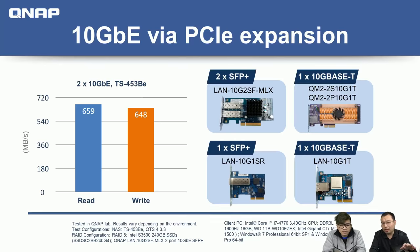If you install a 10 Gigabit card on the NAS, you go far beyond what competitors at the same price point offer, since they are limited by built-in Gigabit ports with a maximum of about 220 megabytes per second. Based on our testing, installing a dual-port 10 Gigabit card and having two clients concurrently upload and download to the NAS yields 600 megabytes per second.